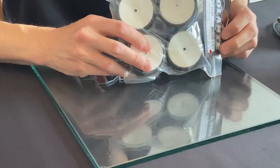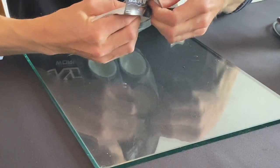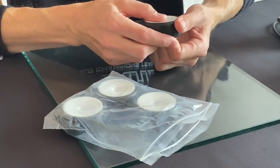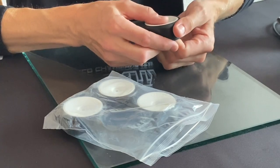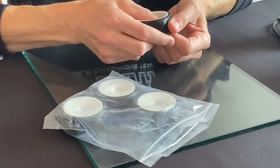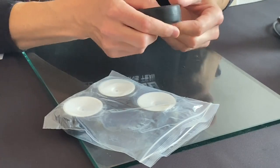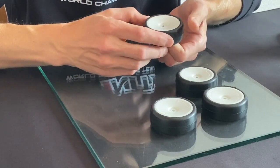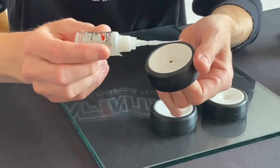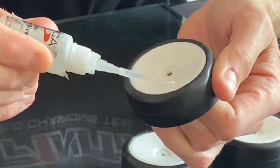So the first example — this is a Volante tire. First I open the package and do a visual check of the tire to see if the gluing is correct, both from the outside and the inside. Push a little bit with your thumb to check if the gluing is correct. All four tires are now checked, and if you're not 100% sure you can still put a little bit of glue around just to make sure.